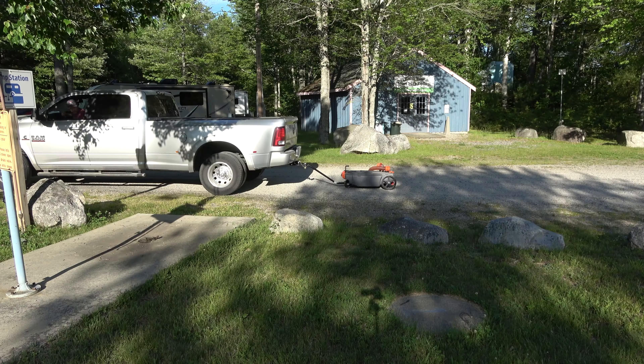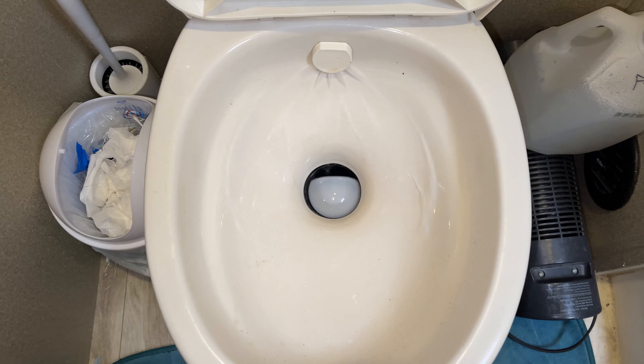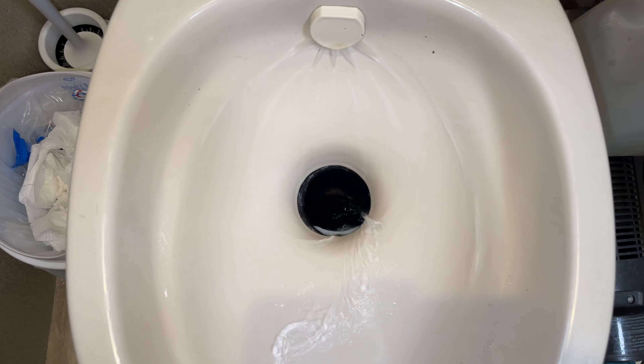We tested the unit for several months while at campgrounds with a sewer connection. We kept our gray tank valve closed and let the gray tank fill until it backed up into the shower or the sink, then read the meter. By doing this many times, we realized that the water would back up at around 55 gallons on average. We have a 50 gallon gray tank, so some of the water was going into the black tank and some was staying in the drainage pipes. This exercise really helped us understand how much water we were using for certain activities.